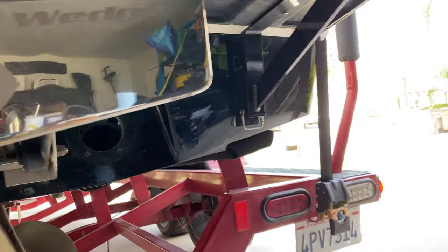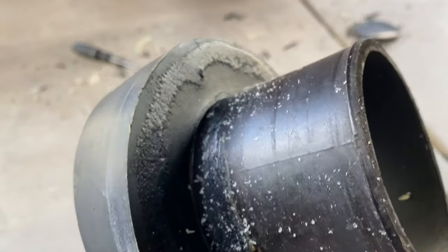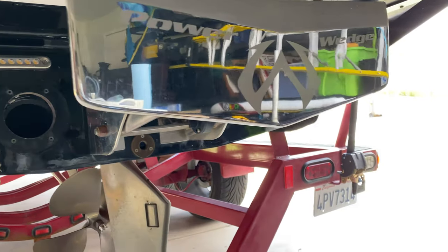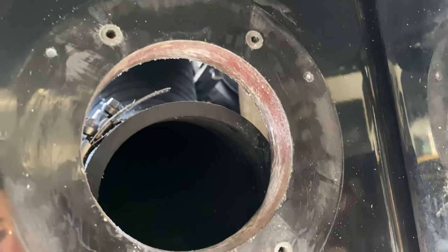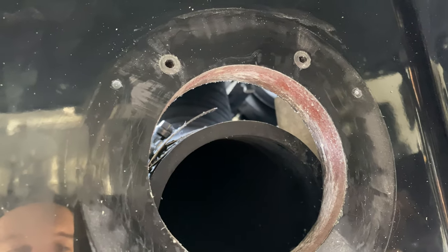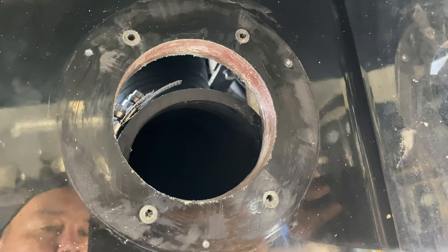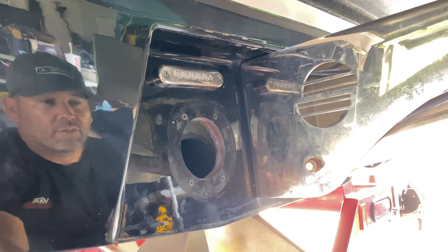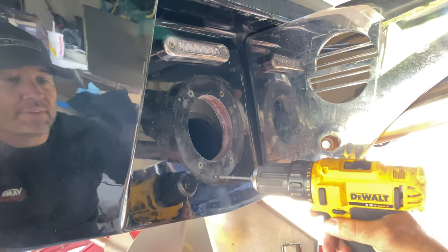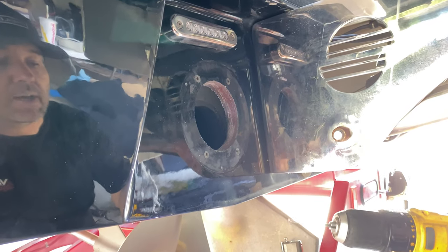We have both sides cleaned up and the old stuff off — not in the best condition, but these are going to the trash can. I scribed it with a pencil and then, before I commit to those holes, I put a very small drill bit on it — just barely hit it, not enough to get into the glass too much — and then I'll put it back on real quick just to make sure those holes line up, because you want those things to be close to center. You're actually supposed to go backwards on fiberglass. I like starting with a very, very small bit so you have the least chance of screwing things up or chipping huge amounts of glass out.